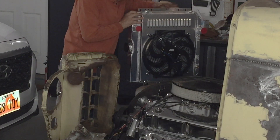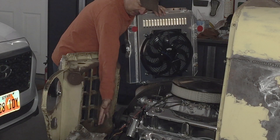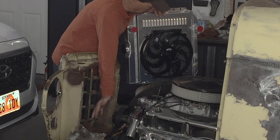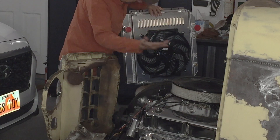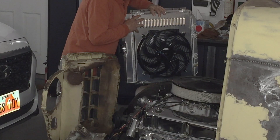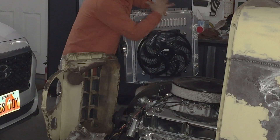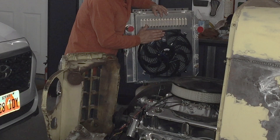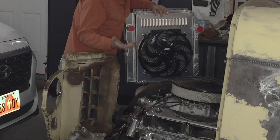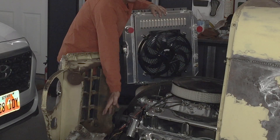One of the things I noticed with the spacer and the original fan blade that goes onto the front of the Mustang engine - it was just taking up too much room. So I opted to go with an electric fan. It has this really nice shroud so that it draws all the air across the radiator, plus it's slimmer and actually adds horsepower because you're taking away that horsepower usage from the fan.